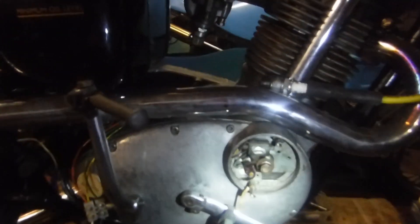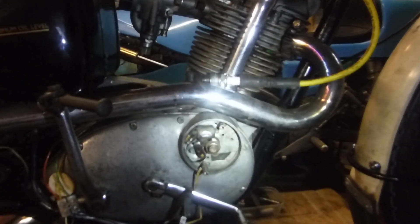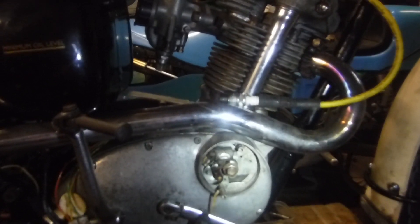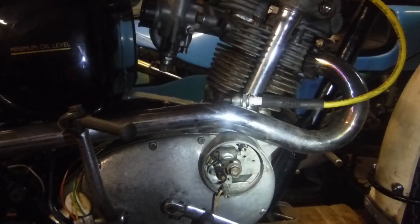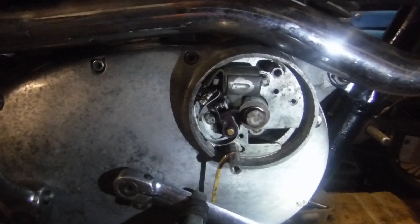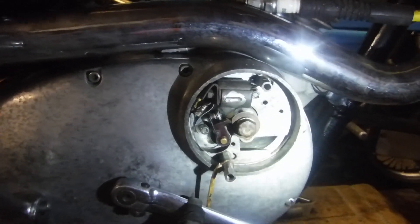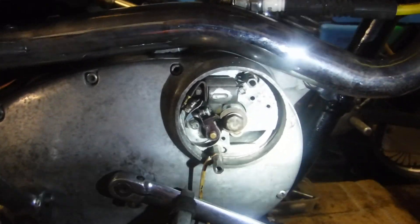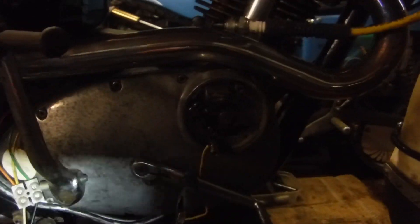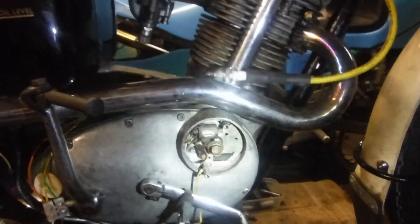The Trident doesn't go out of adjustment frequently, if at all. But those are just some of my reasons. I was sort of challenged about the awkwardness of setting the full advanced timing on one of these — the 4CA and 6CA, the old Lucas contact breaker setups. They've got an auto advance on them, a mechanical one held back by springs, and moving the cam to full advance can be a bit of a fiddle. There are means of locking them on full advance, but even they're a bit of a fiddle, and I don't do that.